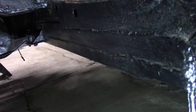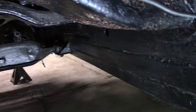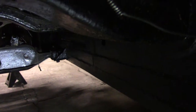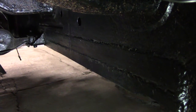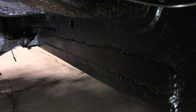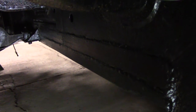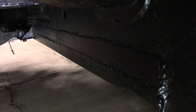We're getting set up on the midsection of the frame rail — this is the Achilles heel of '97 to 2000 F-150s and Expeditions. Where I'm at now, if you look up there, that's your cross member for your transfer case. And you can see welds, and you can see flat steel welded in — that's what I did with a stick welder. I used 6011, that's what I had, and these frame rails were pretty thin and pretty rusty.